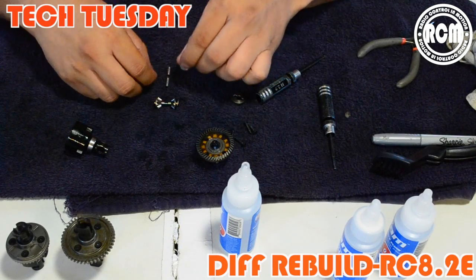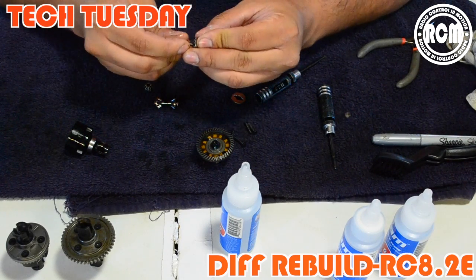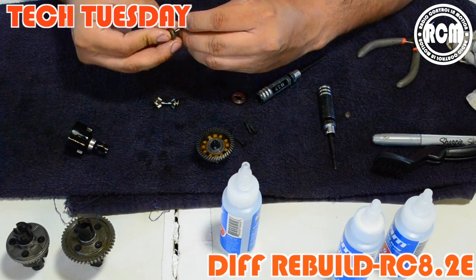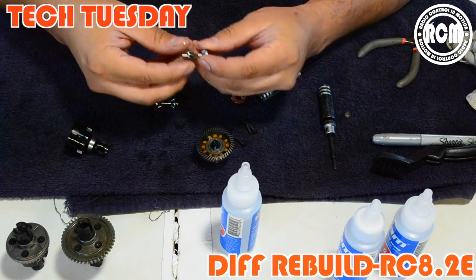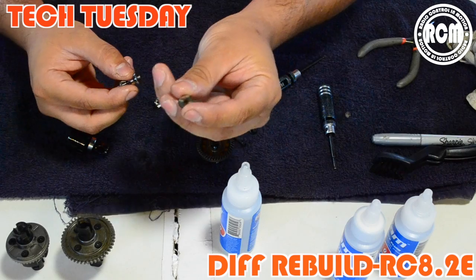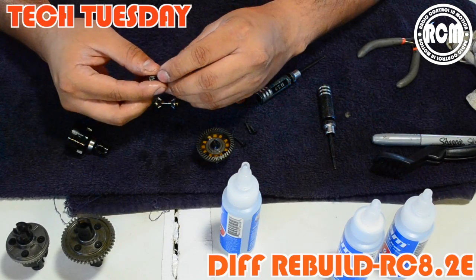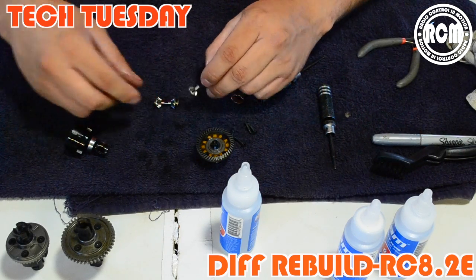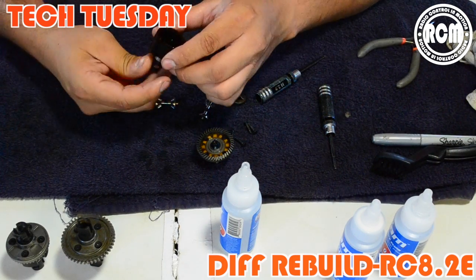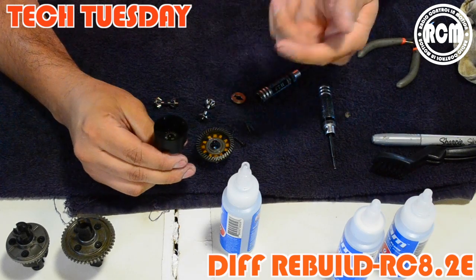There we go. Now there's one thing to note. I've noticed on my other gears as well, my short course, they do include these shims on the end of these spider gears. You really can't see them because they're real thin, but let me pop one off. You want to make sure those are actually still on there when you install them back inside your differential. We're not going to insert them. Some people like inserting them.